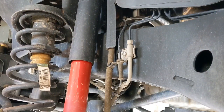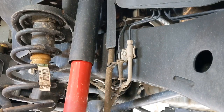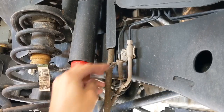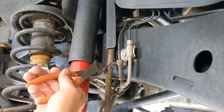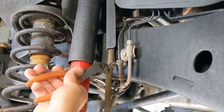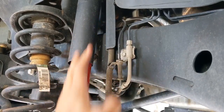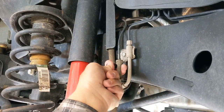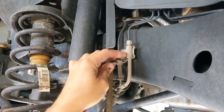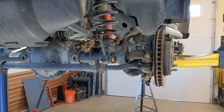We need to pull these sway bar links off first. But prior to doing that, we need to loosen up this bolt on our brake line to make sure that when the axle droops, it's not going to be pulling the brake line down. You'll notice you have your ABS sensor wires here and clips that hold everything together. Carefully take those clips off so when you undo this bolt, the axle can droop naturally. Remove the ABS sensor wire so it's separate. Then let's get off those sway bar links.